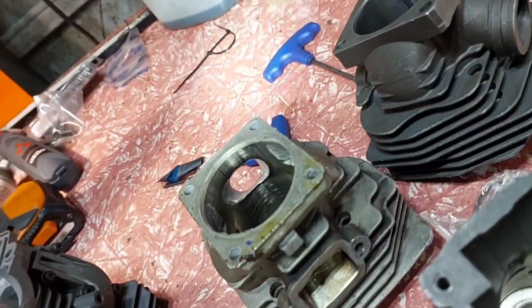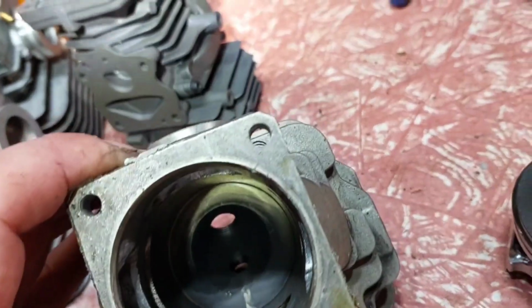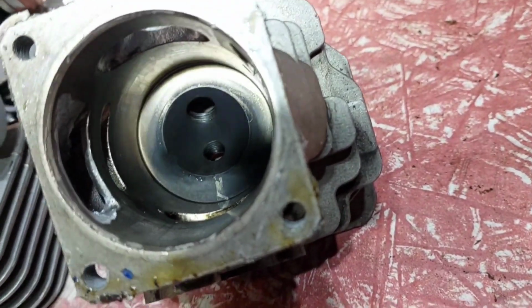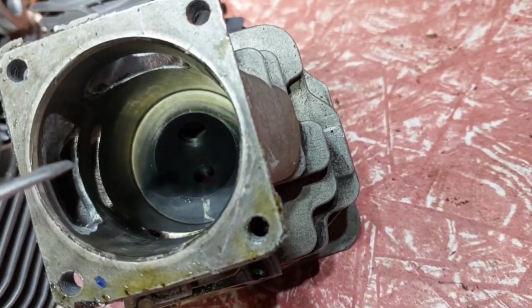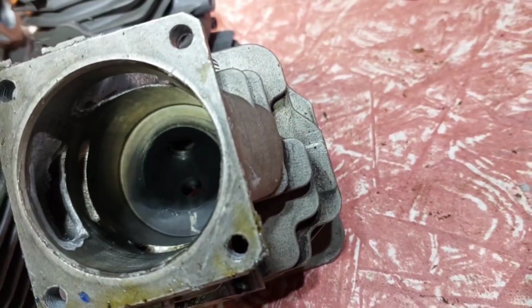Now moving on to Stihl. This is a big bore kit for an MS460. Look at the combustion chamber on that one, it is quite tight, with a really large squish band, but the actual combustion chamber itself is quite a small one. I used to call it blue balls. It kicked and it hurt your arm. It really had oomph. I could get it running once, probably.